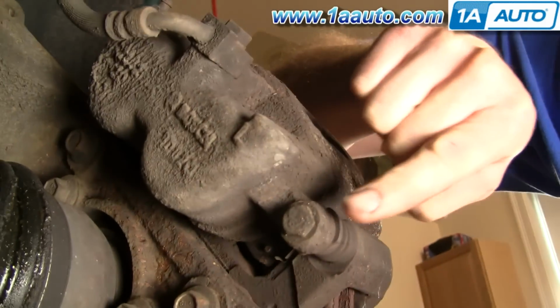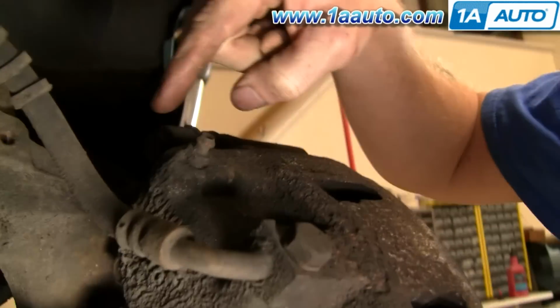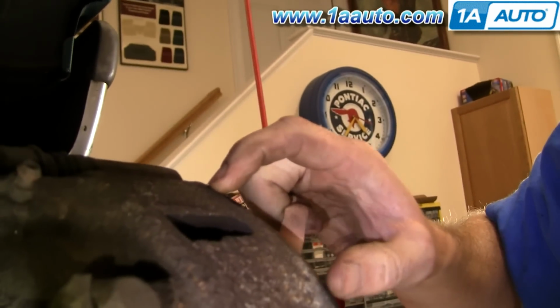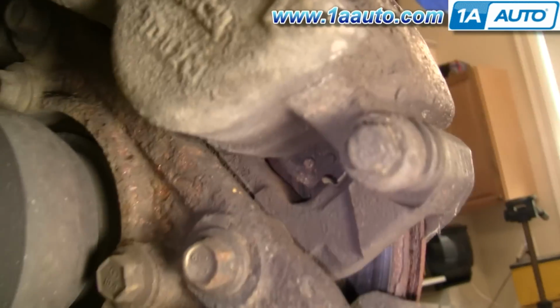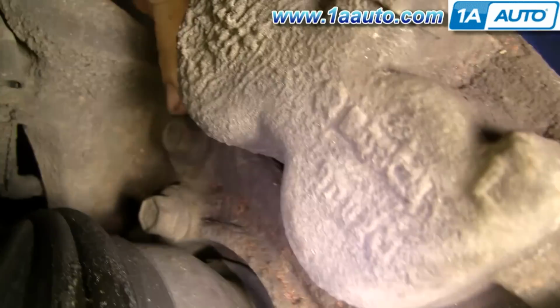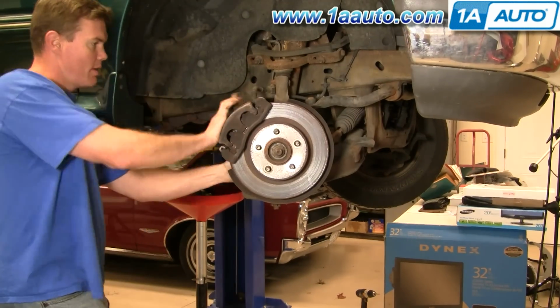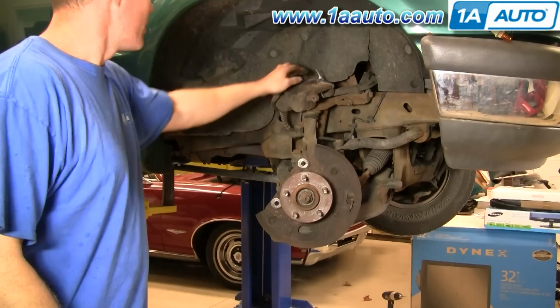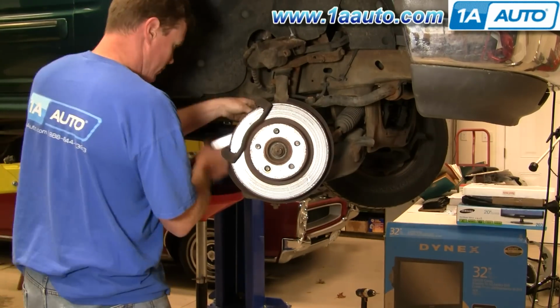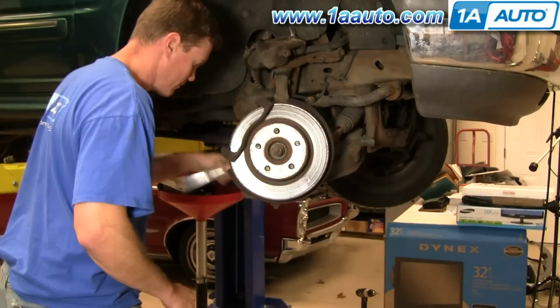And there's 4 bolts that basically hold the brakes on. There's one here, 13mm, and one up here. And those just hold the calipers to this big bracket. There's also a 15mm bolt here, and a 15mm bolt right up here. So we're just going to speed through removing those 4 bolts, and you pull the caliper up and off, and you can wire tie it up top, and then that bracket comes off with the 15mm bolts, and we'll pick it up from there.